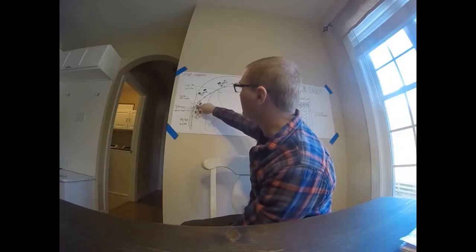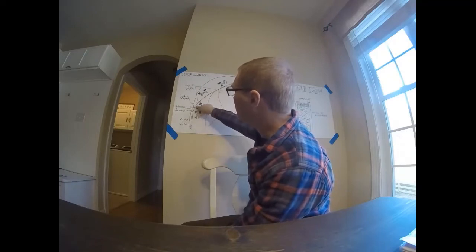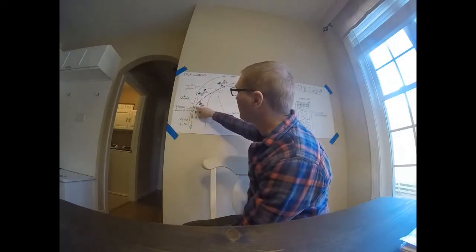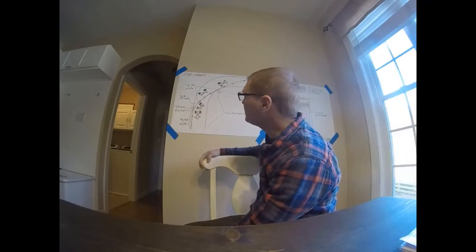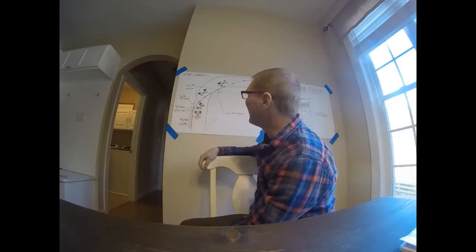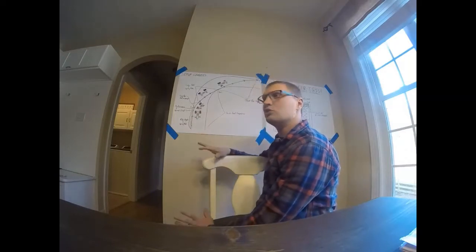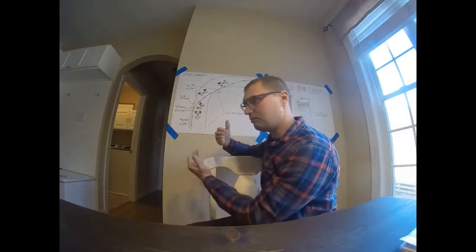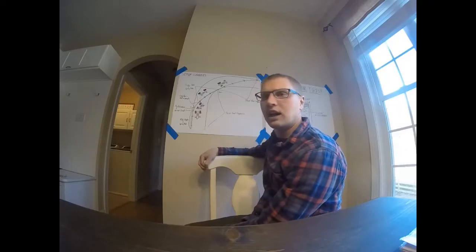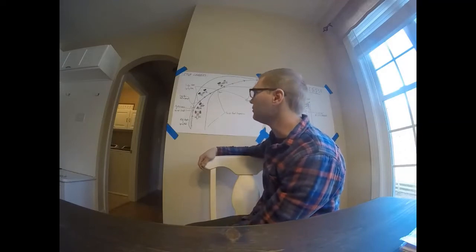I've got a little dotted line here of red and blue. Blue is when you're really not on the gas or the brake. And red, you're kind of trailing off the brakes. If your car's having an issue in this area or you want to refine it, what I like to think of is our sway bars and our brake pad compound. Different brake pads have different release characteristics. Find a brake pad that suits your driving style, not just for how it bites, but also how it releases. The treads are a little less forgiving than slick tires in this manner, and so this is really how you can milk the last bit of speed out of them.